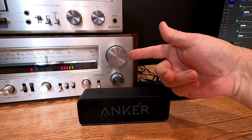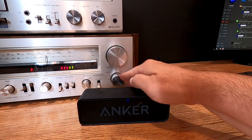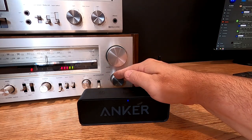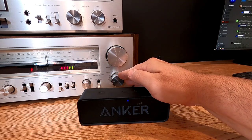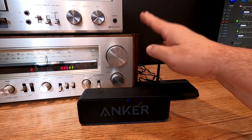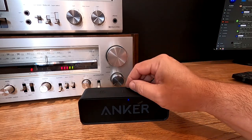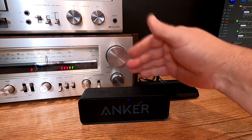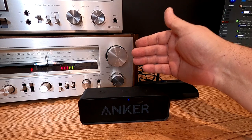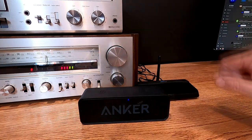When you're using the cassette or tape output — that being a fixed volume — this is no longer the volume control for the Bluetooth output. You still have your home stereo working normally. You can listen to both at the same time: leave the stereo on in your front room and take the Bluetooth speaker out to the kitchen, patio, or yard. Just understand that when you get close to your speakers or main listening room, you're going to have some latency or delay between the two — it takes a second for all this to happen.